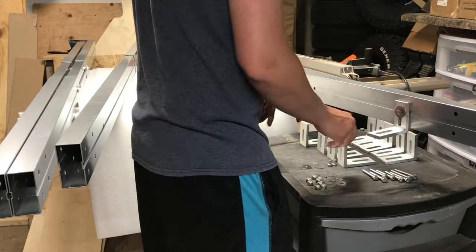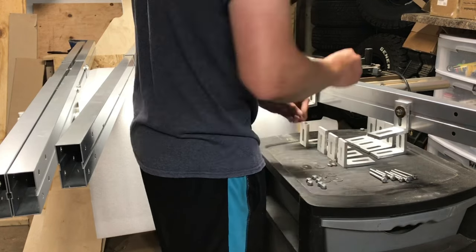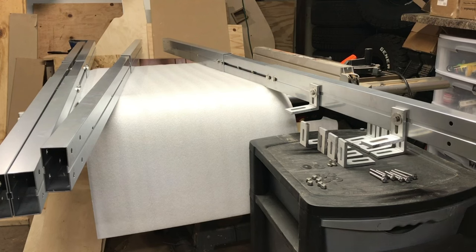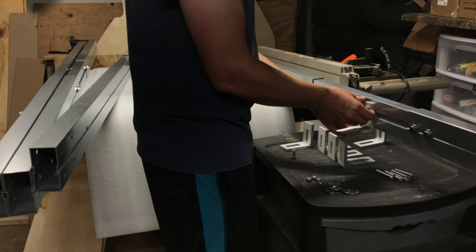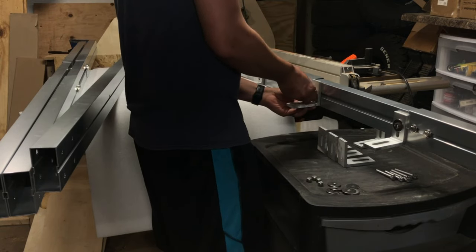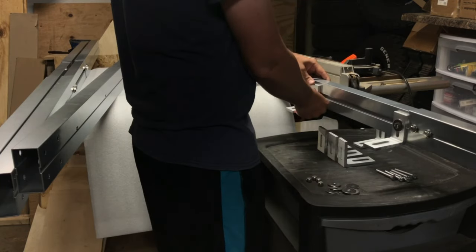So now I'm installing the angle brackets. I've already measured everything. I'm evenly spacing the brackets to spread out the load. Each crossbar consists of three pieces, three sections of tube — it's a sort of telescoping system. That's what makes it a universal ladder rack. But the middle section has a T-slot and it accepts square nuts. Lucky for me, I had some extra parts — a whole new bag of hardware because I had one of the brackets fail. They sent me a whole new box. I used two additional square nuts in that T-slot. That's how I'm going to put the brackets on the middle section of the crossbar. That way I can avoid drilling holes any more than I have to. But the outer sections of the crossbar, I did have to drill through. One crossbar will have six brackets and the other will have four.